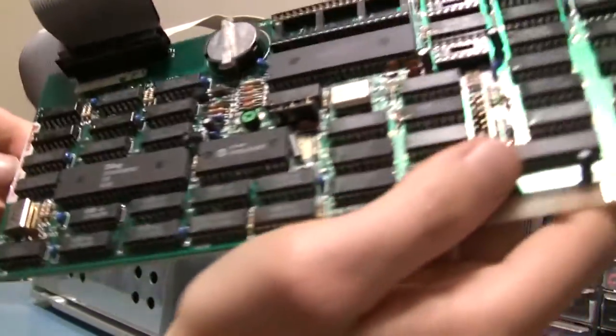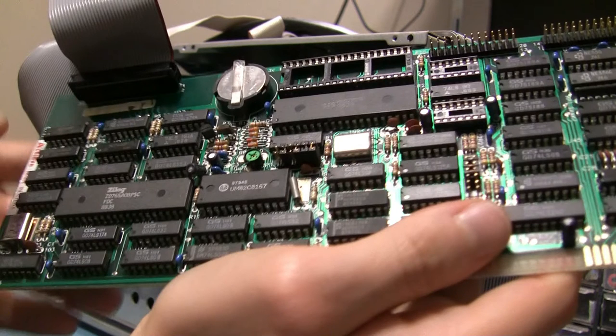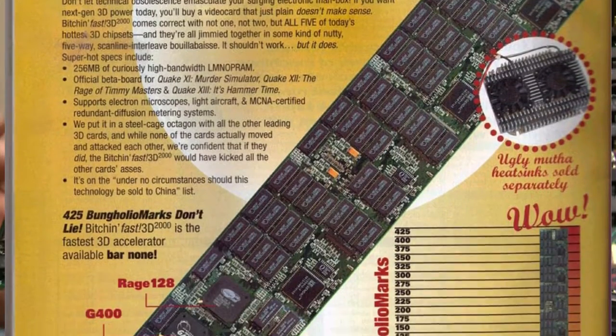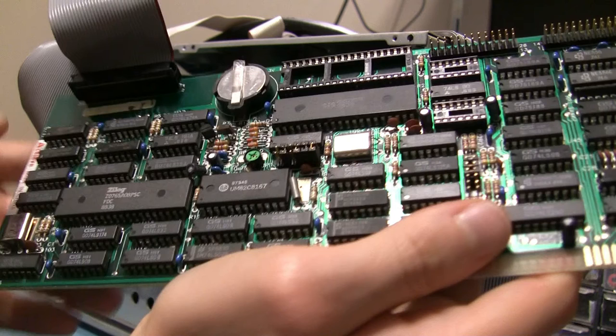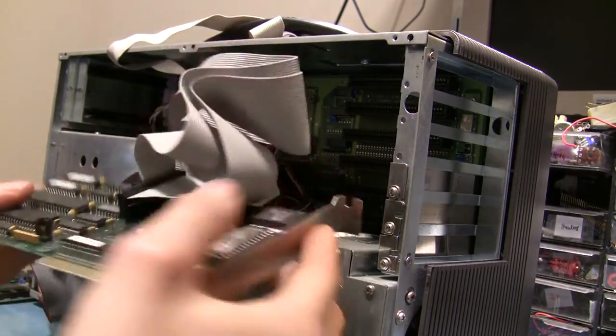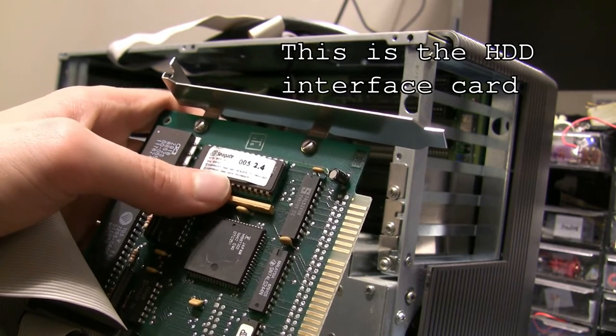At this point I'm realizing the machine is an IBM XT clone. The XT, along with its clones, shares a common fault: the motherboard is very bare in terms of I/O. Almost everything has to be added by expansion card except for the keyboard, and expansion slots are very limited. People put as much as humanly possible on one card. The card I pulled out has a floppy controller with ribbon cable going to the drive, a real-time clock with backup battery, a couple of serial UARTs, and it also handles joystick and parallel port functions. Copyright 1986–1987.